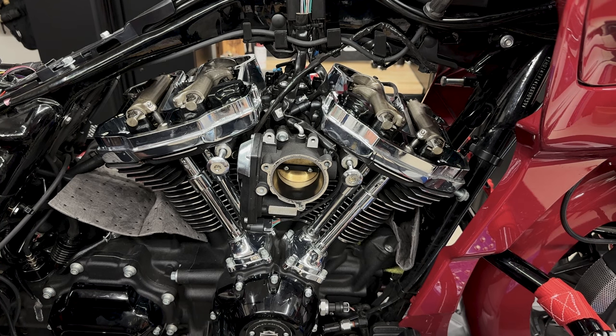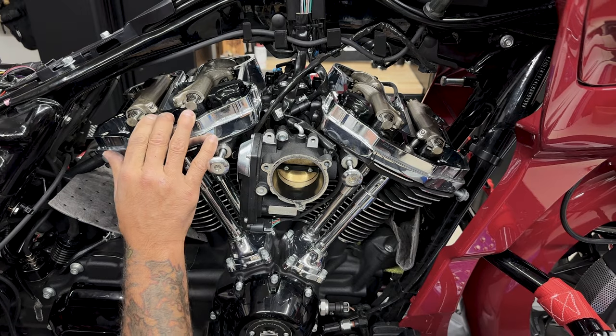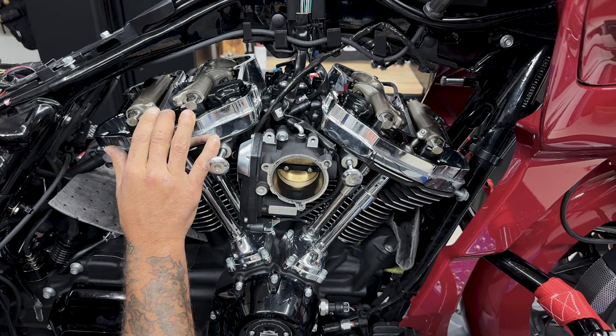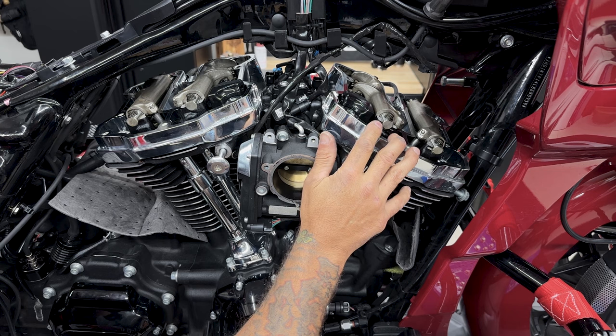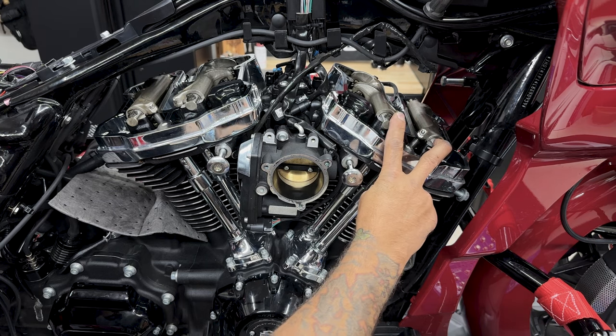So now you see the exhaust is opening. Now it's closing. Now they look like they're both moving together. That means the front is at top dead center. That means it just has less tension and we can remove these rocker arms.